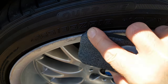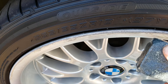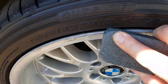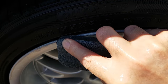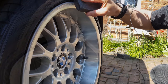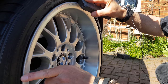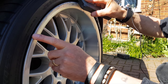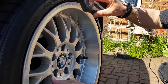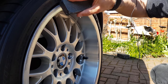So we can angle the whetstone slightly, and we don't spend too much time on one bit, otherwise it's going to be obvious you've done some work there. So yeah, soapy water, keep doing the whetstone. That's almost gone now, that one. And I really don't think I need the whetstone around the corner down here, because that's pretty much flat. And we can do the rest of it with the 3M headlight polishing kit. I'll show you what I do in a minute.